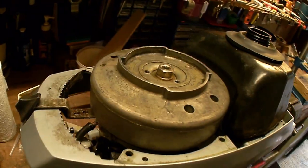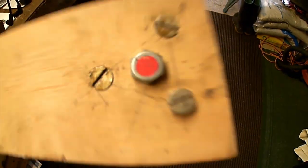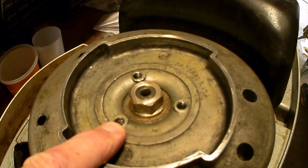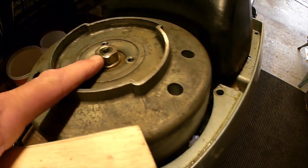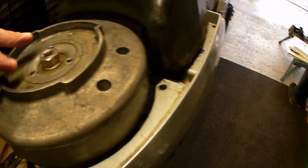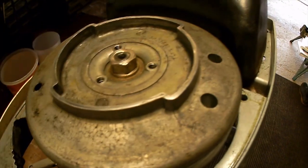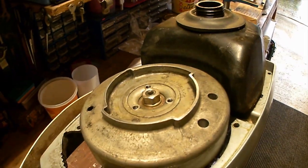Revealing the magneto. This convenient piece of wood — I've drilled four holes in it and put some bolts in — is going to act as a puller for these on there, and that will bring all of this off. It's a taper fit on there. I'm going to have to use two hands: essentially I'll hold it in with those three bolts, I'll take this holding nut off, and then I will wind down on this centre bolt which will pull the whole lot off.